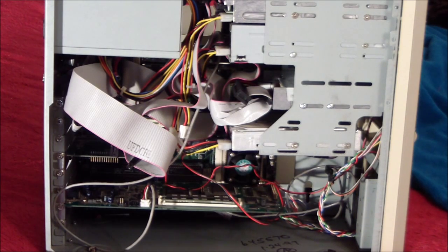It's even more insidious when you boot up the machine and it posts. It said something like L2 cache activated or available. So even in the POST, it seems like there's L2 cache, but if you run a program like Cache Check, there is no L2 cache. It's completely fake. The one plus side of this board, though, is that there's a slot for a proprietary module for L2 cache, which I do happen to have in this machine. They're not common at all. Sometimes they go for outrageous prices on eBay.